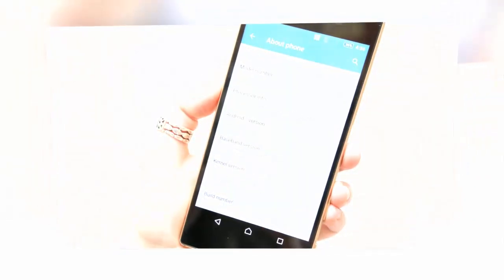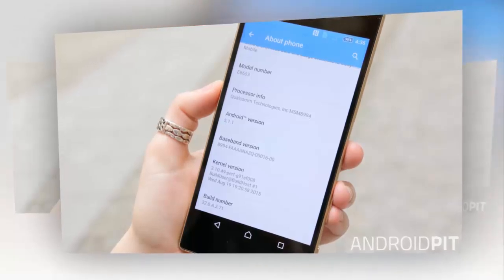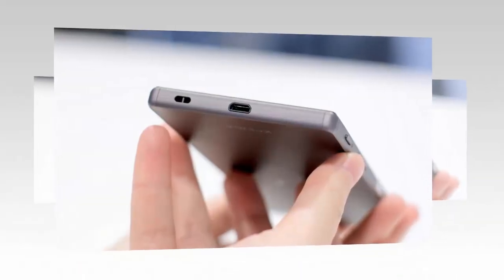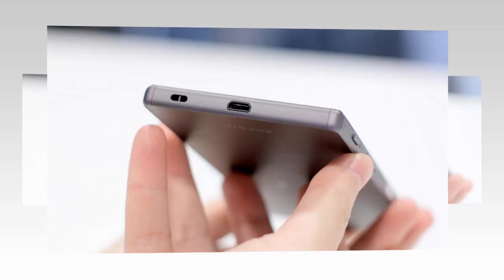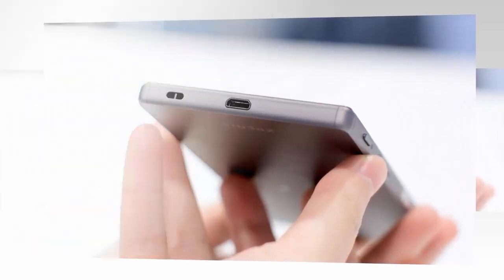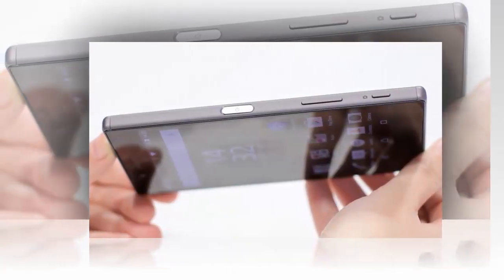Sony Xperia Z5 has no network coverage. If you're experiencing issues with network coverage on the Sony Xperia Z5, your first mission should be to reselect a network mode by heading to Settings > More Mobile Networks. From there, tap Preferred Network Type, then select a network mode. Experimenting with these settings and then restarting the phone can do some good.